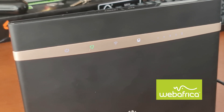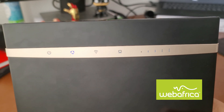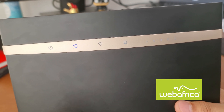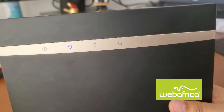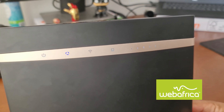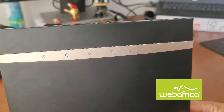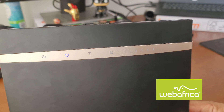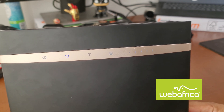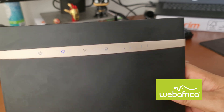Things to take note of — on here we're going to see a few things. The power light is going to be a solid white light. The light next to power is going to indicate to us whether or not we have internet access — we want that light to be a cyan or light blue color. The fact that it's dark blue at the moment indicates that the router might not be configured for the SIM card yet, so we're going to have to log in and apply one or two settings. We've also got the wireless LED next to the mode light, indicating the router is broadcasting a wireless signal, and the LAN indicator and signal strength on the side.